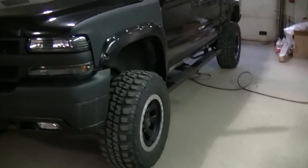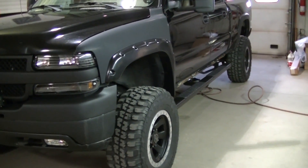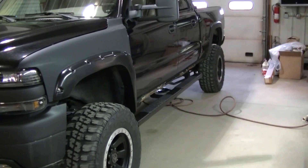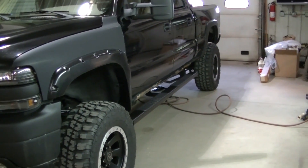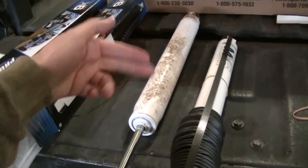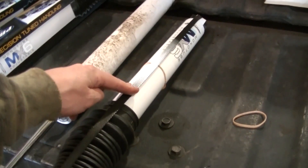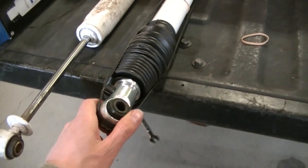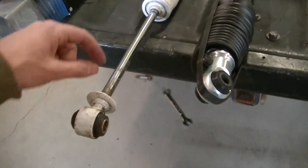We're going to find out. I'm going to get these on the rear - the front ones are messed up so I don't have those yet. All I've got is the rear right now. Another thing about a twin tube shock is it has to be mounted a certain direction. The mono tube gas charged can really be mounted any way, and they actually want you to mount this adjuster on the bottom, which is where the piston is - the opposite of the Super Lift shocks.